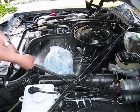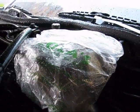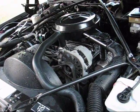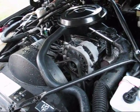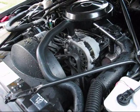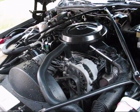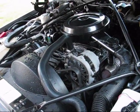Now you're ready for the rinse. After you're done rinsing, remove all the covers. As you can see, just putting that bag over the general area — that's as dry as we need it to be. Once you're done rinsing your engine and engine compartment thoroughly, go ahead and start your car — that will allow the drying process to be faster and the air pressure from the fan will blow some of that water out. Just make sure you don't run it too long, below five minutes is best, because we still have to put the final touches on.